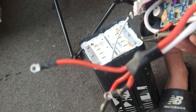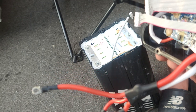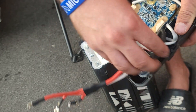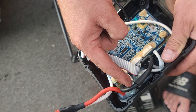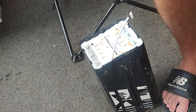I'll make my own because I've got fisheye crimps at my shop. I'll add new fisheyes onto three pieces of wire — this is number 12, I'm going to use number 10 or number 8, something bigger. Then I'll come off of here and drop onto each battery terminal, because this is going into the BMS and these three wires are coming out of the BMS. So I'll just put the wire straight onto my battery, overriding all this battery BMS jargon.